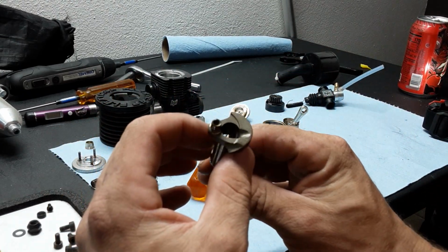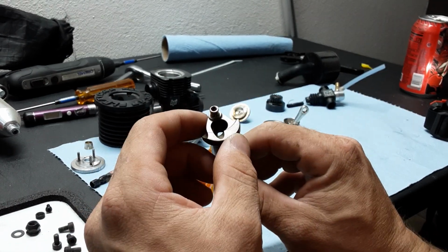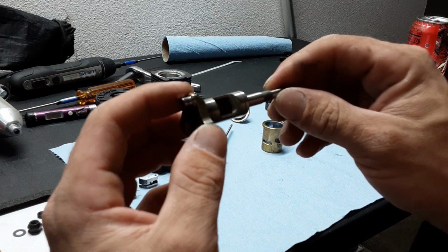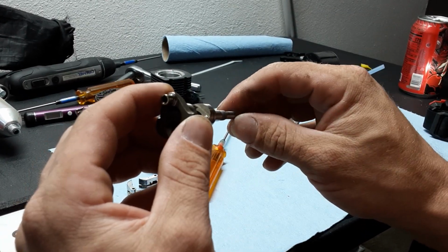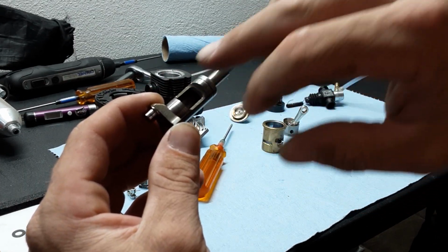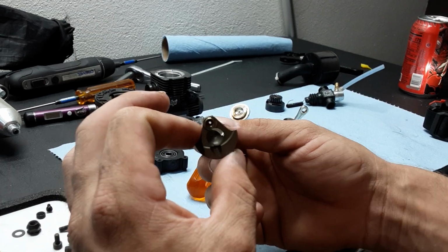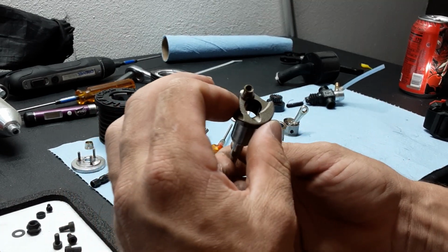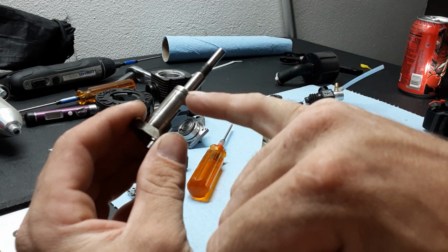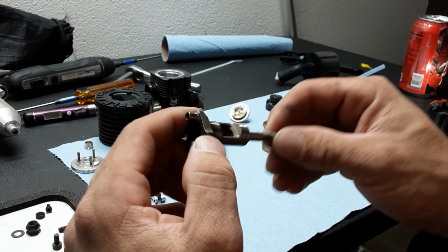Okay, so our crank is a typical Force crank. It's got the shark fin cut on the leading edge. It's got the little scallop thing here. Looks really good. The induction window's amazing. It's even slightly ramped right here on the edge. You can kind of see that. That's interesting. They could have sharpened the leading edge a little bit, but they didn't. But still, I could see where you could still mod this. You could absolutely open this up. It's not massive, but it's really nice, just for an RTR engine. You got your fluid seal. Still a really, really nice crank.